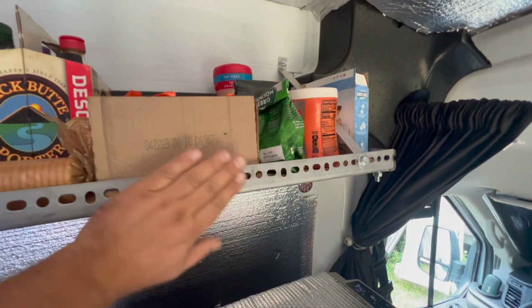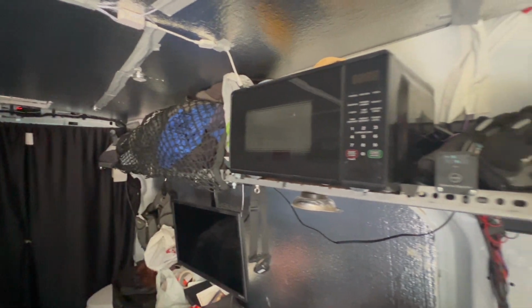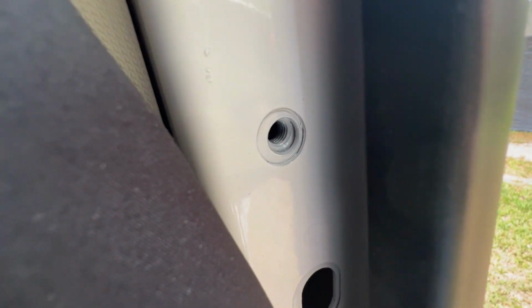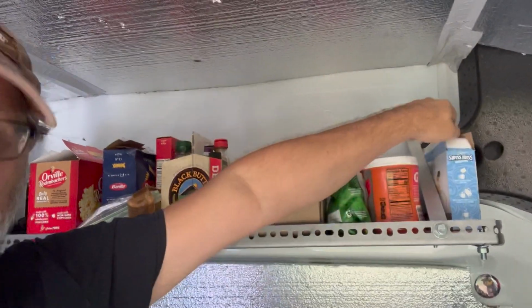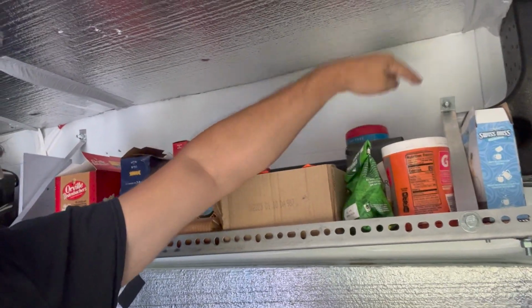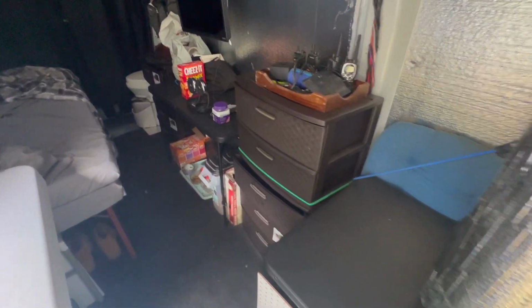Might recognize this stuff, angle iron. And this is a 1 foot wide shelf that extends 12 feet all the way from the front to the back of the van. Tons of storage up here. The Transit has lots and lots of pre-threaded holes like this one. I can put a bolt straight into that right now with no modification at all. So I used a lot of those to bolt things in, like the shelf behind me. It needed a little help and a little extra support, but these are just aluminum straps bolted again to mounting points on the wall and through the angle iron, and it works. And like I said, this is all temporary.